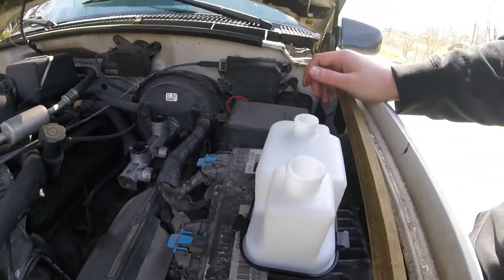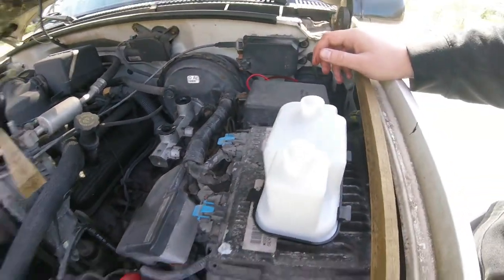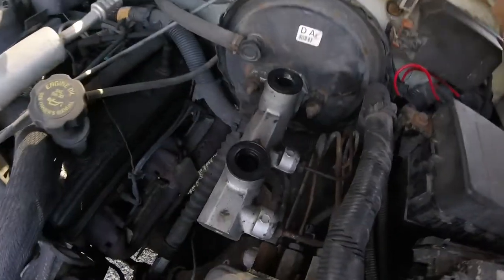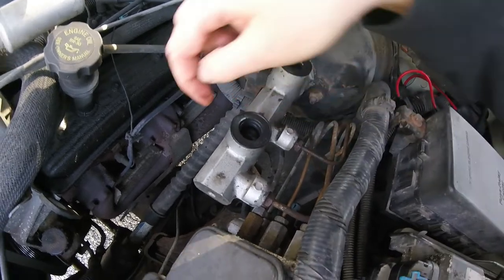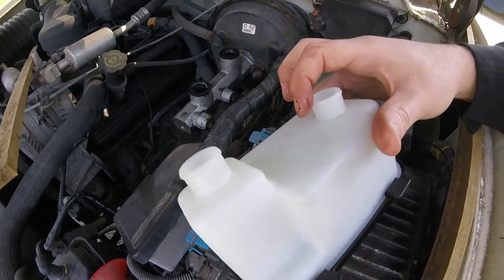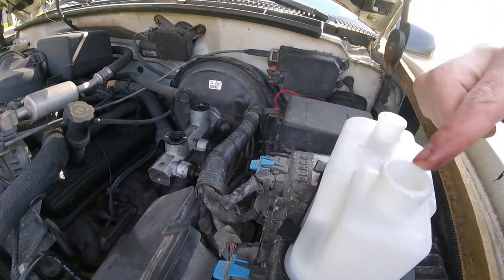Okay, update. There's no way you're gonna be able to put the tank onto there with the seals on it because they're too rigid and it's too small of a hole. So I took a screwdriver and carefully pried the seals off of the reservoir — there's just a tiny lip that holds them — and then pressed the seals down into the master cylinder. I even had to use a screwdriver to help guide them in because it's a very snug fit. Now I should be able to lube these holes a little bit and put the reservoir in over the seals.